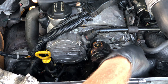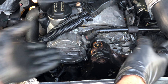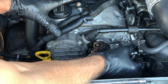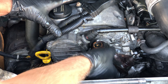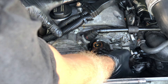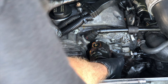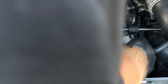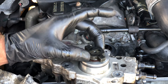Getting back to the high-pressure fuel pump — sometimes it's easier to pull the pump off before you go after those hose clamps. Here they were already replaced with a 7 millimeter, so I've gone ahead and pulled those off. Then the high-pressure pump wiggles out. We don't want to drop this piece right here, and some fuel is going to fall — too bad.